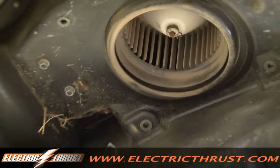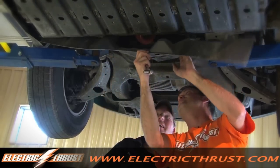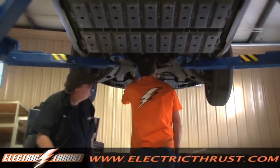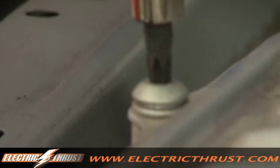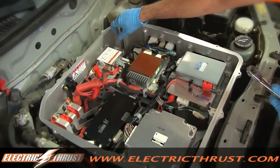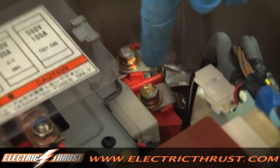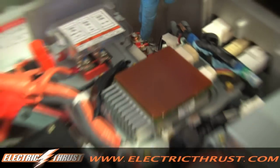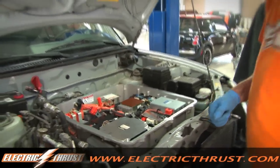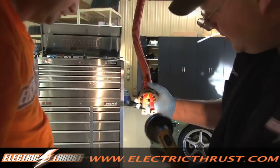The pack is pretty wild — the fans are incorporated into the pack. So we've marked our terminals here. We've got positive coming in and our negative ground right here. We'll disconnect these two and that will release it from the controller. All the juice comes through this baby.